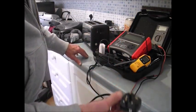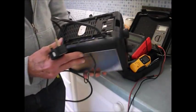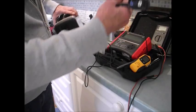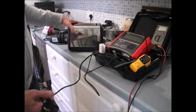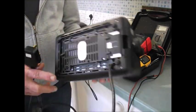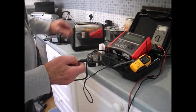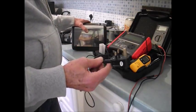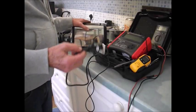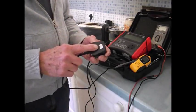And check the size of the fuse as well. For an appliance like this, you'd only want a 13 amp fuse. This is 850 watts. One kilowatt draws just under five amps, so this, being 850 watts, will draw about three and a half, maybe four amps. You might say you can get away with a three amp fuse — well, no, you won't, because when you first turn an appliance on you get an initial surge and it'll blow the fuse. And if it doesn't blow the first time, it'll blow it pretty soon. So you have to have a 13 amp fuse in there.